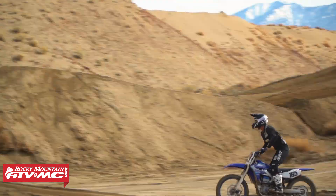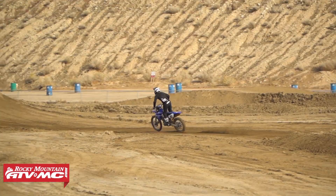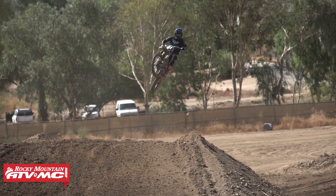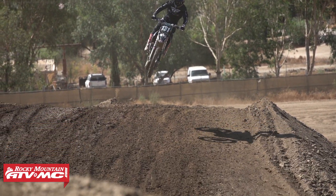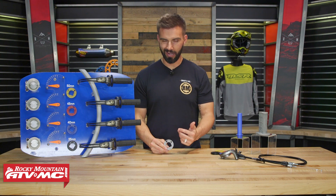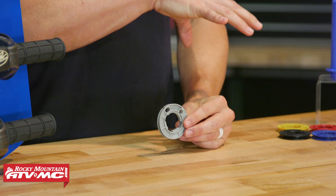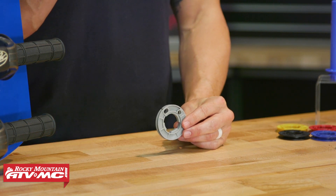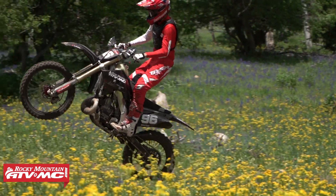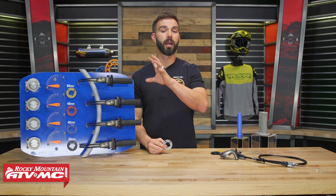The lower the number, the more you have to twist the grip to get that valve to open up — that's a good visual of exactly how it works. It's a really cool kit and a great way for riders to customize the throttle rate according to their needs, riding style, and wants. Now the last thing I want to mention: there's also the gray cam, which is the off-road version. There's no measurement on this, but they say it'll be pretty close to your stock reel, but it kind of ramps up a little bit right towards the end — so you have your same power delivery, maybe a little bit softer, but then it ramps up towards the end.